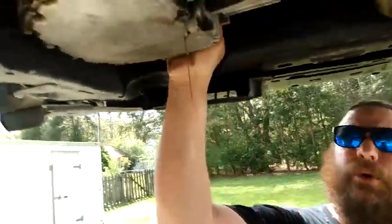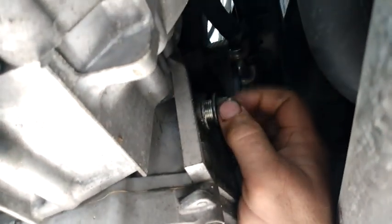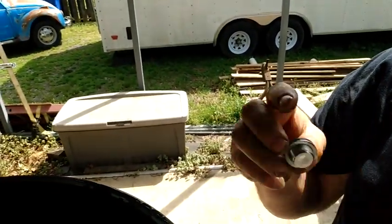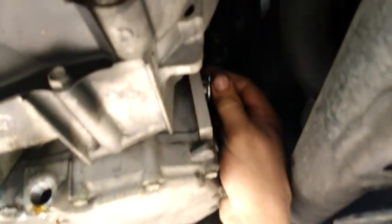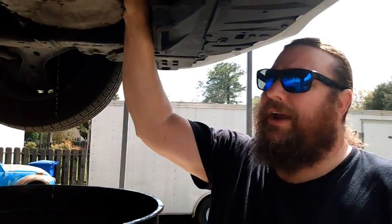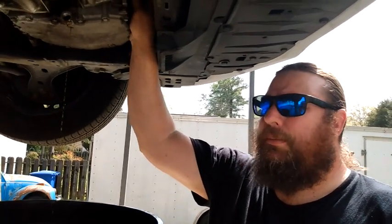Here's the sight bolt — this is where the fluid will run out once it's full while the engine is running. If it drains out while the engine is off, that doesn't mean much; you could still be low. You have to start it and run it. What I like to do is pull that bolt out, make sure it can come out — this is where we're going to measure it. Put it back in and fill up to the point where it starts to trickle a little bit, so I know I can start it and it won't be dry.